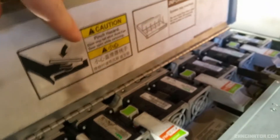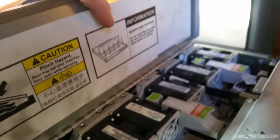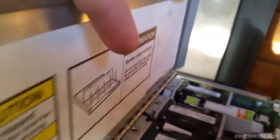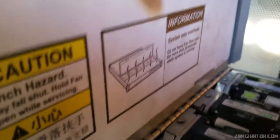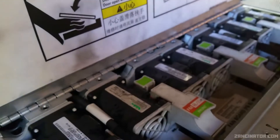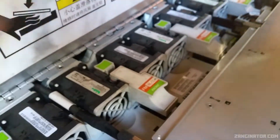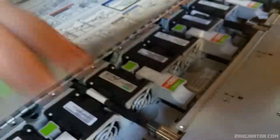You can just shut it back like so. There's information on the inside of the cover — watch out, you might catch your fingers. The server might overheat if you keep this open for a long period during servicing. Personally I don't think the whole system would overheat, but if you're running SAS drives in the front they might overheat, since this design is more about pulling air through.